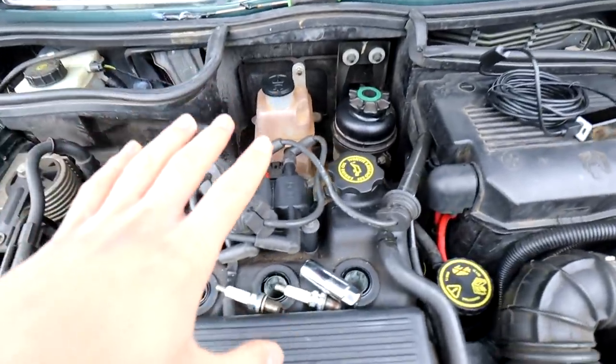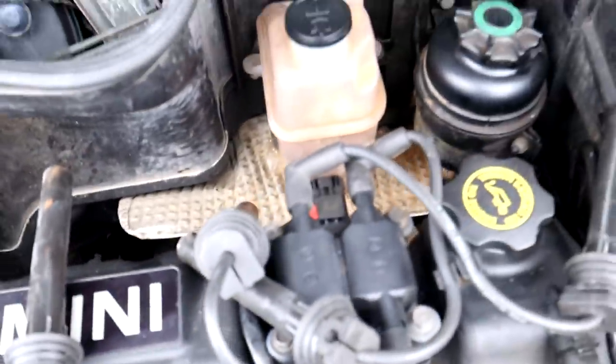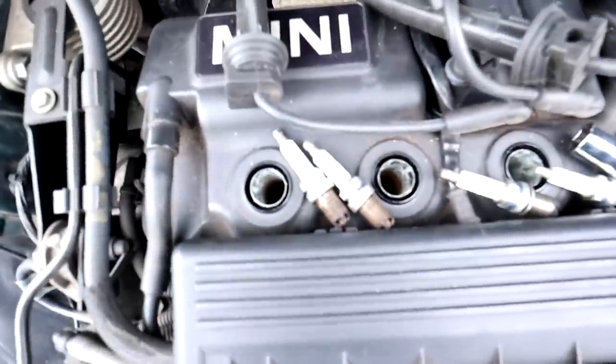After all that saying the head gasket hadn't gone, turns out we are doing a head gasket on this car. It's not the end of the world - it means more work but also more content for the channel. The weird thing is we haven't lost any coolant whatsoever. When I first filled it up I drew a line with a pen and the coolant level is bang on that line, so I'm not sure where the coolant is coming from.